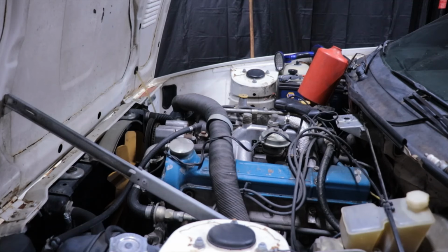And maybe another day sometime or another, I'll pull that carb off. Like I say, they're kind of a pain to get off. You got to get in there with a little short wrench, and you only get like finger turns at a time. The best way to really get them off is to pull that whole intake system off, and you got to pull the thermostat housing. It's a bunch. But anyway, let's see whether it'll run off this one carburetor, and if it does, that'll be great.